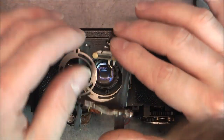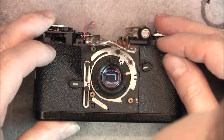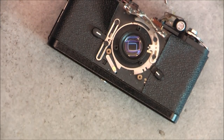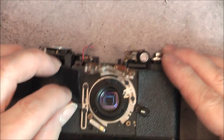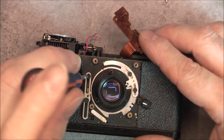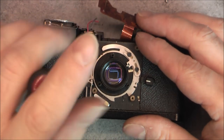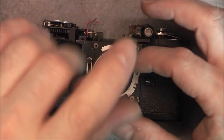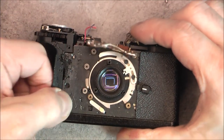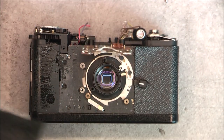This is coming off. Now I can get rid of all these parts and try to make some progress. This screw was not tight at all again. Now I can completely pull this piece — and it is a good idea because obviously we have more screws hidden behind. This is a very typical construction of most cameras, even reflex cameras — you will find the main body with your film carrier assembly, motors, mirror, and shutter assembly screwed in at the front.